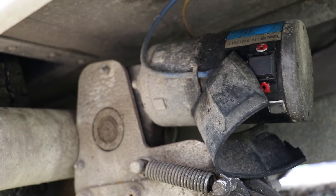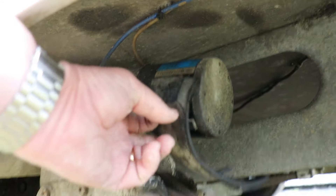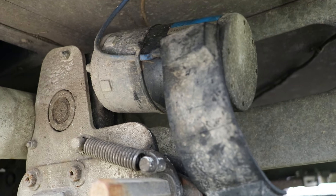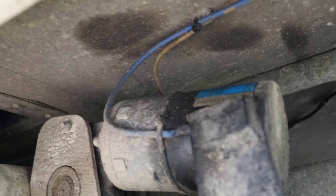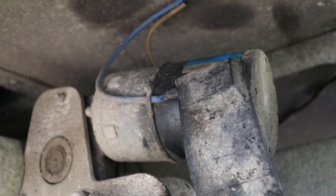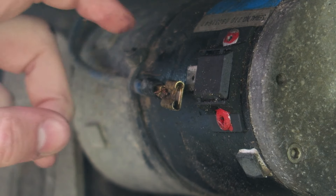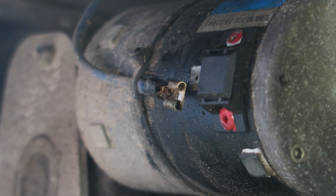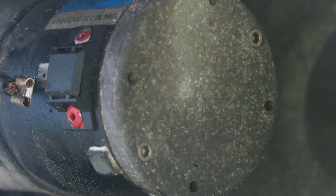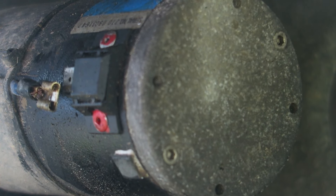This is the motor mover, and as you can see here the existing rubber ring has completely disintegrated — it's completely fallen apart, and this is what allowed the filth to get through. So what we're going to do is disconnect the terminals — there's one here and one on the other side as well. We'll disconnect the terminals, clean them up using the brake cleaner and the wet and dry, and then put it all back on again. The other terminal is completely hidden from view at the moment on the other side of the actual mover itself, so Tom has to get underneath and run around the back to take it off — and that's the one that's going to be filthy because that's where the cover actually failed.